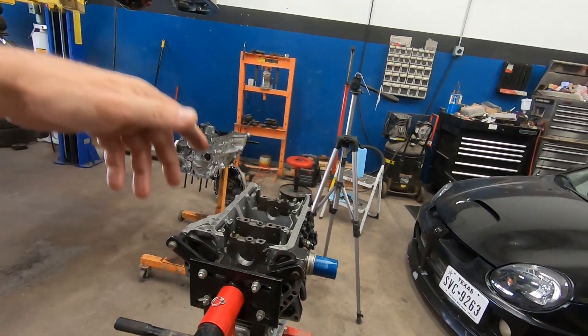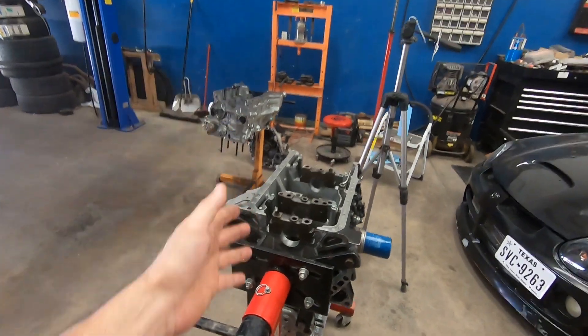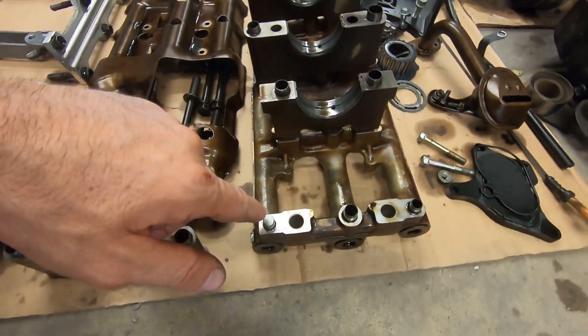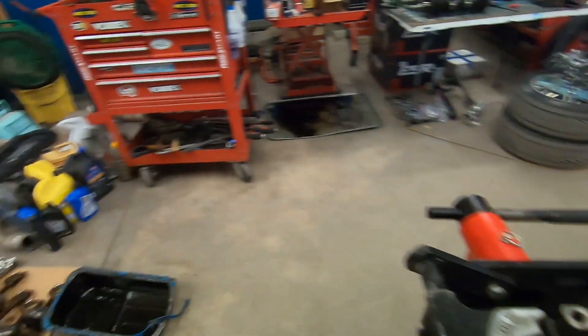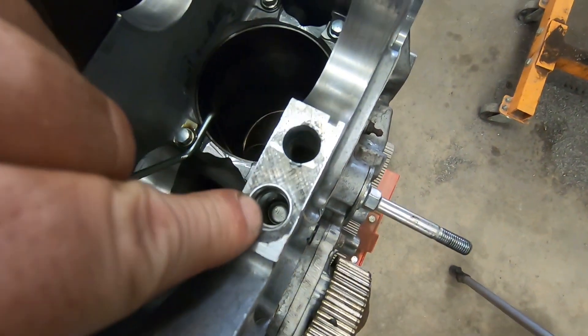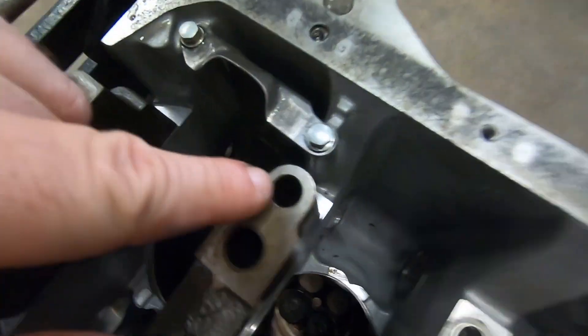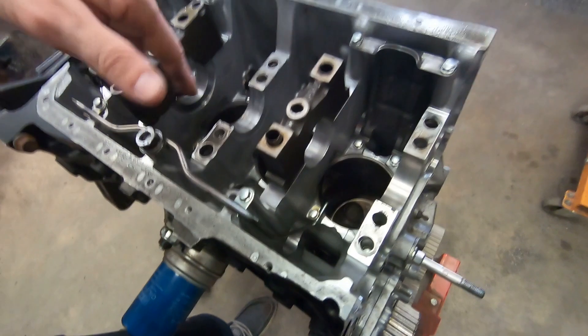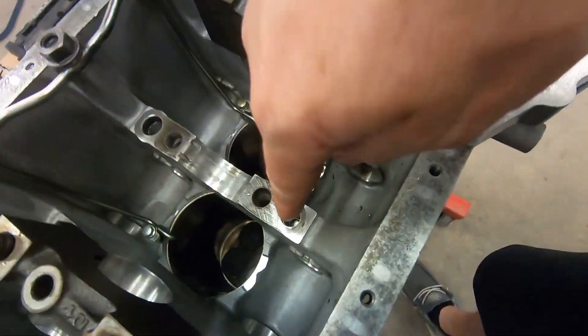I took the time to compare the counter shaft delete kit from the kit installed on the A4 to the kit on the H22A now. It appears it is installed correctly - it's just a different kit that does it a different way. On the A4, the oil distribution rail has plugs that cap off the distribution feed to the actual shafts. On this one they did it differently - they put freeze plugs in there and capped it off right at the journals. So it's all capped off throughout. I was wrong in my theory that it wasn't installed right.